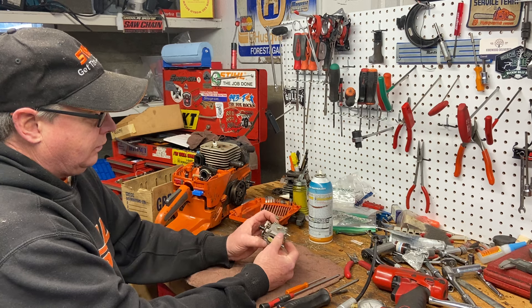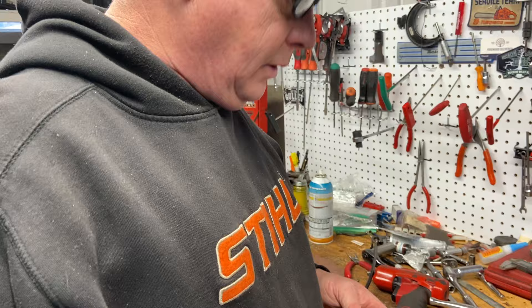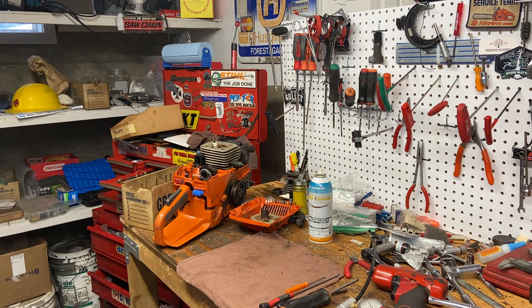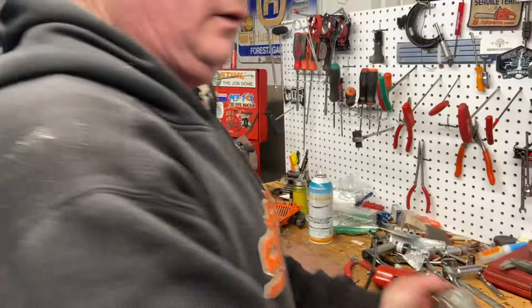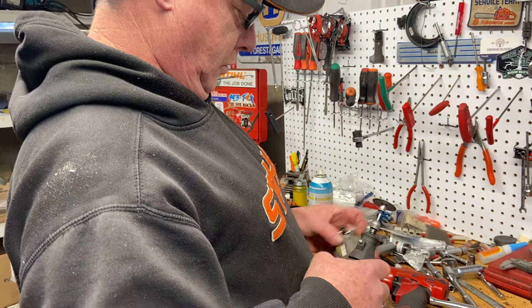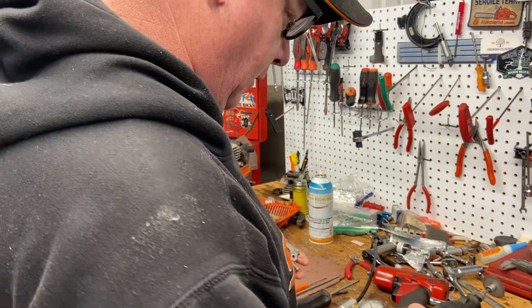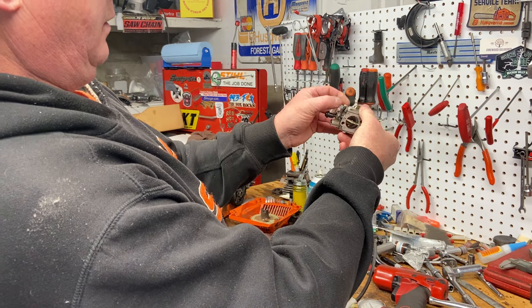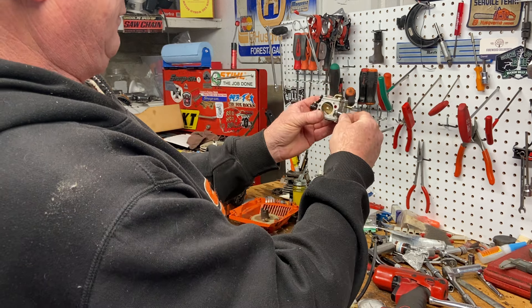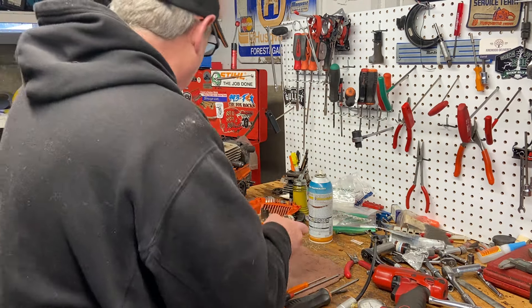As for that fast idle issue — it seems to be working now, but it's missing a couple little grooves on the top. Let me make a couple little notches with my die grinder — just this little zip disk unit. Just a couple little notches on there. Look at that — that works now! That's all you need to do if you don't want to have to buy and replace that piece. Simple. That's fixed.